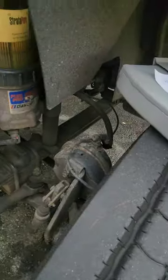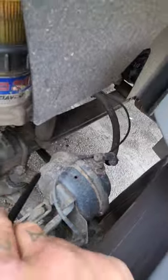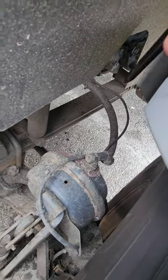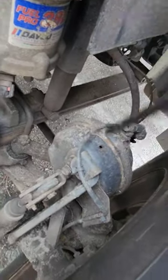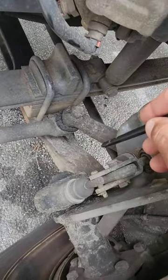So let's go ahead and check the brake chamber. You've got the rubber hose, no audible leaks, no abrasions, bubbles, or cuts. The ABS wire, which is right here, no illegal tape, corrosion, or burns. My brake chamber, no audible leaks, secured with a C-clamp. The push rod and slack adjuster, secured with two pins and a cotter pin.